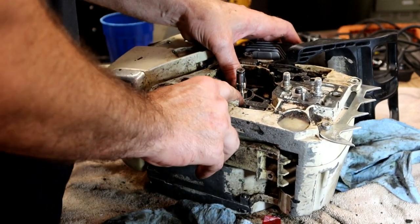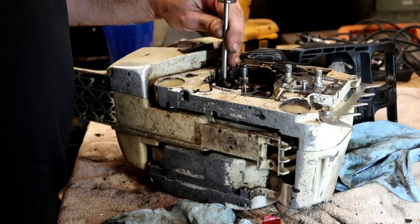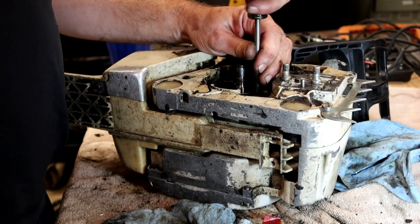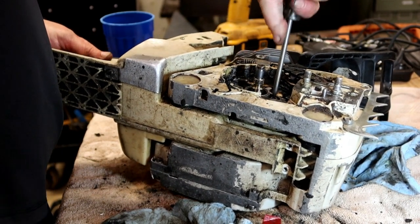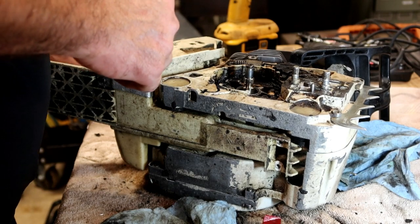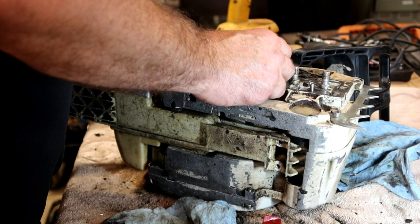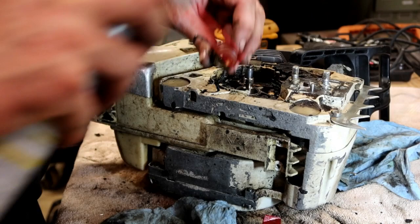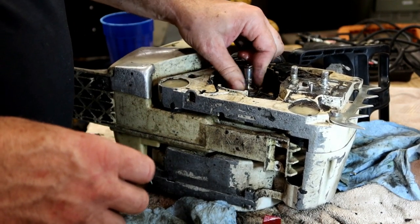Mash that so that it's flat into those pieces. Just tighten those up evenly. Should be oil pump next. Really confident, yeah. Should be oil pump next. It goes with the teeth in. Doesn't need lubrication, I'm just cleaning some of the dirt off. Right, just make sure it drops in and can turn.